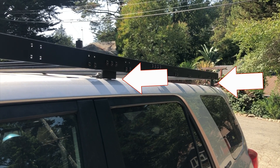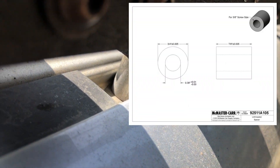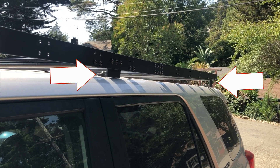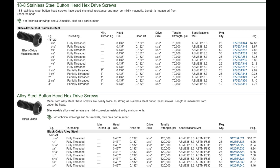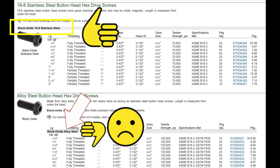The mounts I made using aluminum angle — here are the specs. You can get it on McMaster, Metals Depot, or Online Metals, like the side rails. You need spacers between the original mounts and the new rack of this size. If you use angle all the way down the sides, the front spacers will need to be about a quarter inch longer and the rear ones about an inch and a quarter longer. The bolts that attach to the roof need to be 50 millimeters long with an M8 by 1.25 thread pitch. All the other fasteners I used were quarter-inch diameter, 20 threads per inch button heads — stainless black oxide coated. Don't get regular steel black oxide; that will rust on the roof of your car.